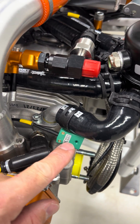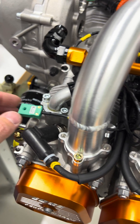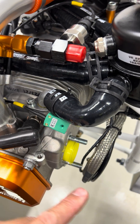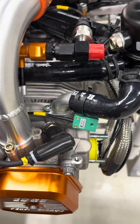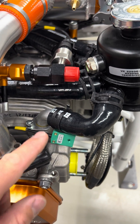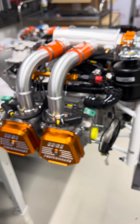As you can see here, on all four cylinders we have EGT probe connectors, so we will have EGT probes — just like the 912, 915, and now also the 916 IS engines — tapped directly into the ECU, which the ECU will use to run the engine in closed loop EGT.